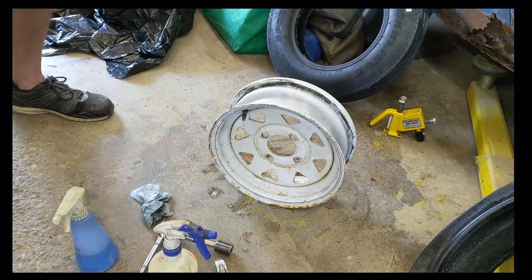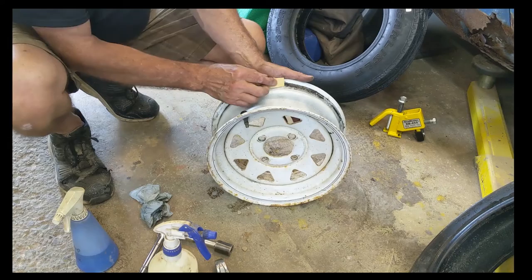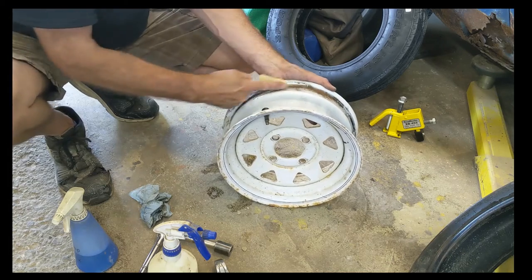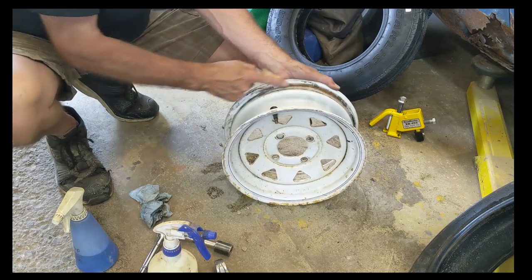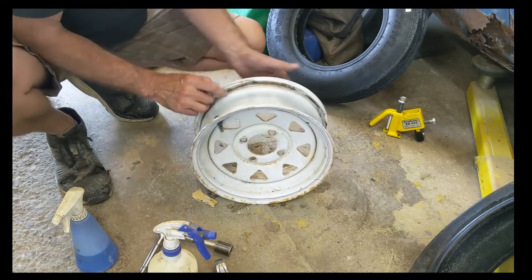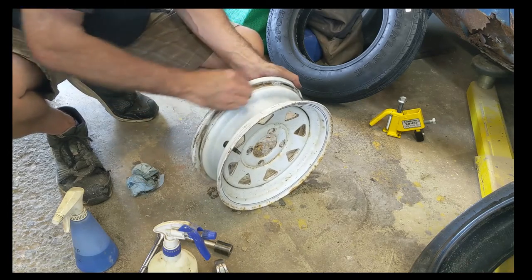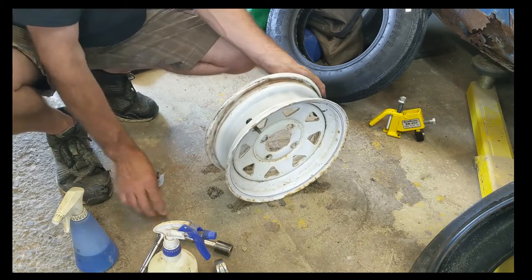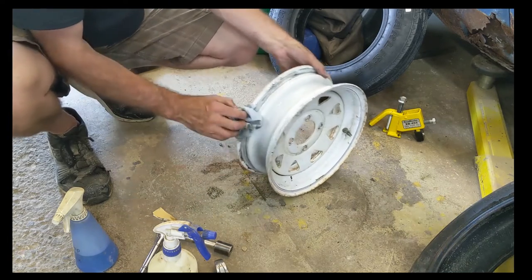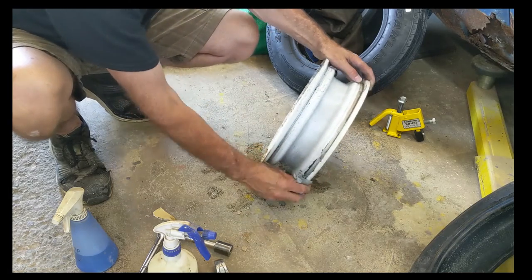I'm going to grab a little sandpaper and give that a touch up. I got a little piece of 220 sandpaper — just going to give this a little touch up. I don't like that bit of rust on there. Get rid of that. I'll check the rest if there are any more spots like that. Then clean it again, get the old residue off. Any rusty spots that feel bumpy — yeah, that's a potential for a leak, so you want to get after those. If the rest is nice and smooth, there's no reason to go sanding on them.